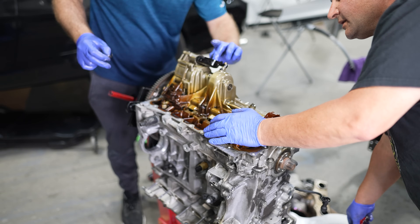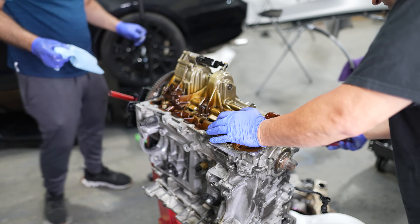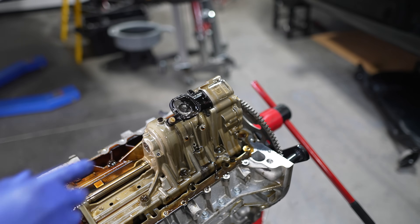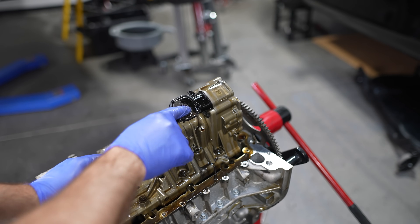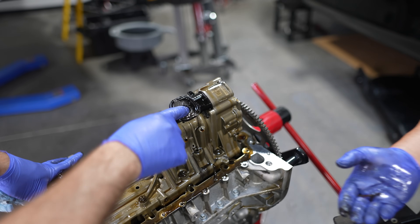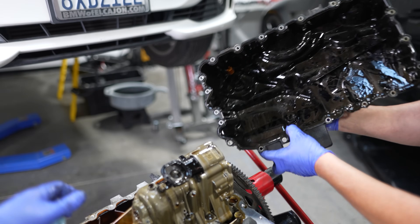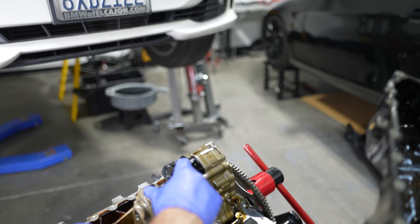Here's the timing stuff — that's why. You can see more chunks right there. So we already pulled out a couple pieces of plastic out of here. It would appear as though this oil pickup got starved. We have bits of the lower timing chain guides that clogged up this pickup, and that could have caused it to be starved of oil. You can see we've got a glitter show in here, but it makes sense that this was starved of oil.